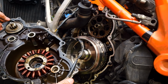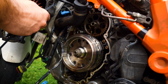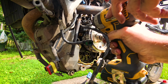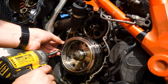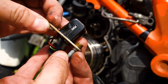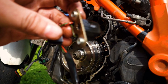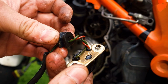Secure the cover so that it does not hang on the wires and get to the crankshaft position sensor. With the removal of the sensor, I did not have any problems, and removing the sensor itself, visually, no damage I found. The only thing, it is very strange that not oil and gasoline resistant wires were used here. The insulation of the wires turned into plastic, the wires wouldn't bend, and I think the insulation might have burst.